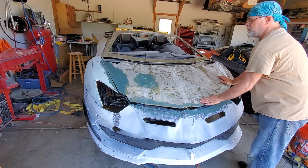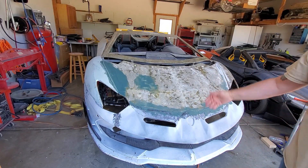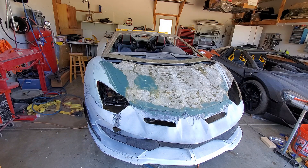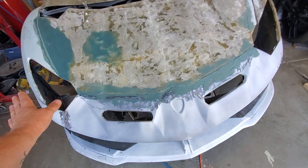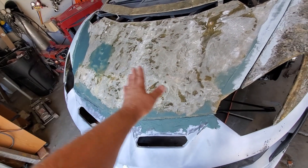The beautiful part is that you can close the hood and, as you can see, it goes on there nicely. Now that we've got everything solidly mounted, I can start smoothing this all out, getting the edges in Dura Glass, and then we can start doing some body filler.